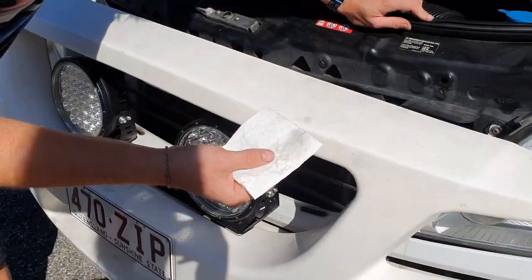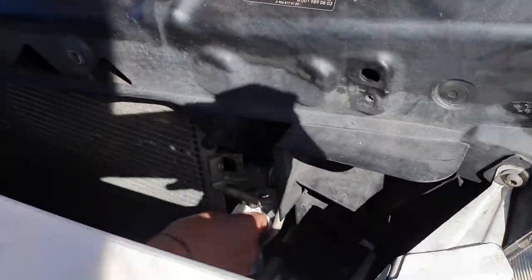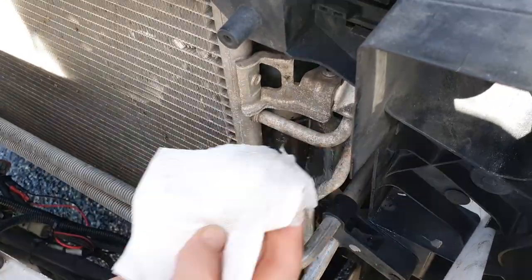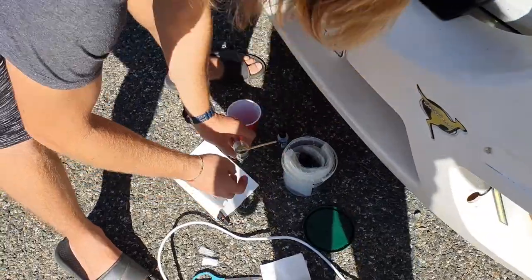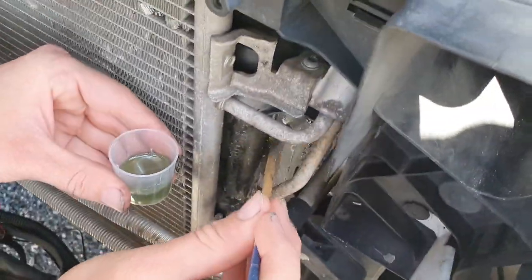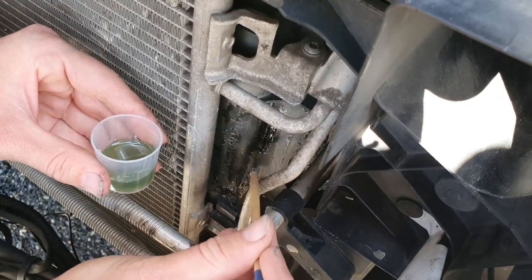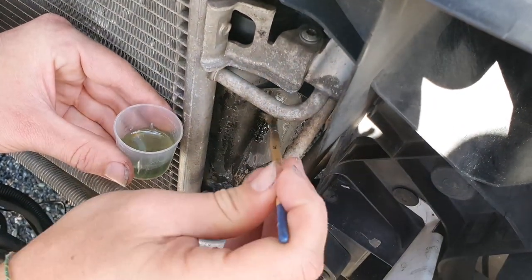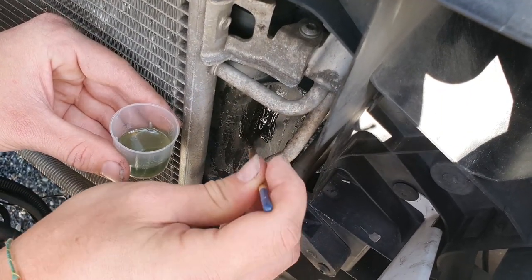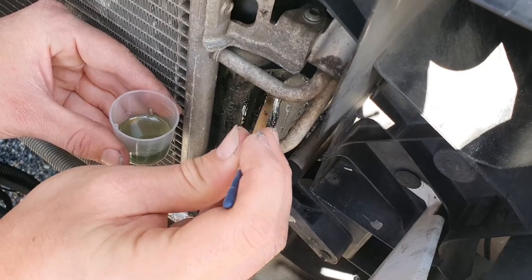Before you put on the fiberglass, wipe the area down with some terps or some solvent again, just to get the dirt off. And then when you put the fiberglass on, you want to put a layer onto the material before you actually put the mat on it. So you want to get a good layer of epoxy in there. And on the walls, just to make sure that it sticks to all of this stuff.